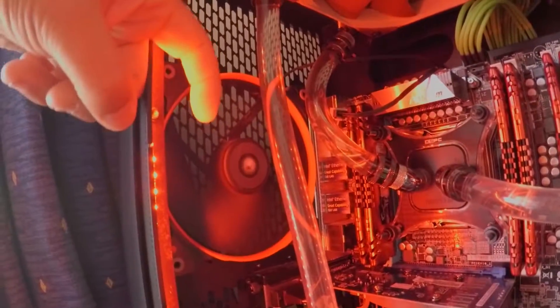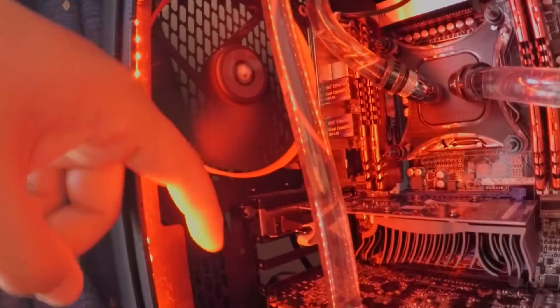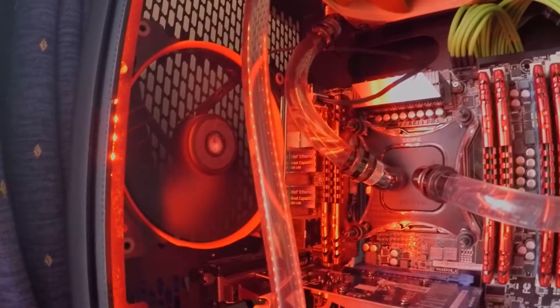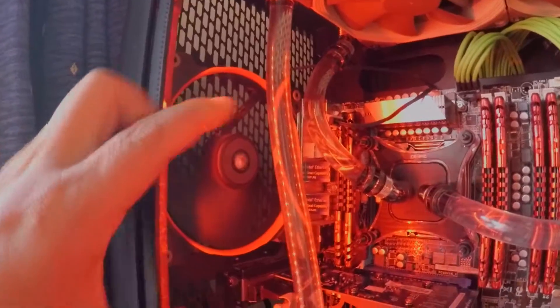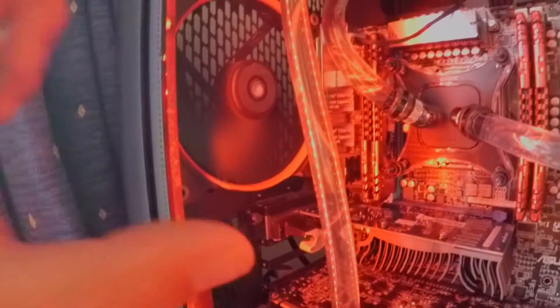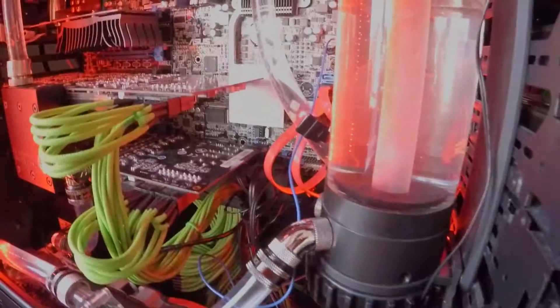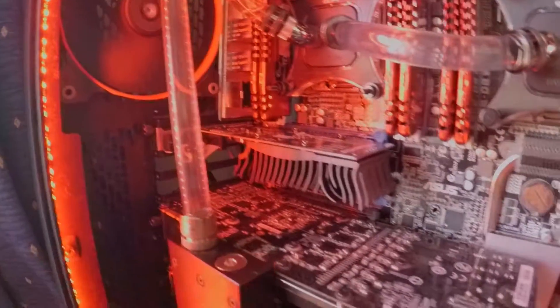Have the top go into the fill port, into the reservoir, and then down and out into the GPUs. So basically put a reservoir pump combo there. The reason I need a reservoir there is because I don't want to slow it down or speed it up too much. My idea is to have it flow into a reservoir so it almost acts as a buffer — kind of slows it down so I can adjust the D5 pump accordingly. Then have whatever pump is there go through the two GPUs and the rad at the bottom, and then back into that pump.